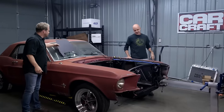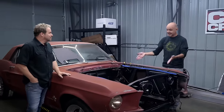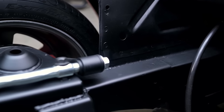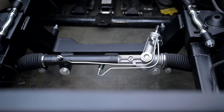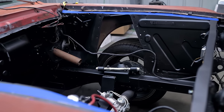We are back from the Power Tour and back here working on the 67 Mustang Coupe. This thing looks great under the hood. We spent a little time doing a super clean on all of the metal, replaced some of the seam sealers that were all crusty from the factory, blew apart the suspension and finished up any welds we may have missed during mock-up, got a good epoxy primer on it, and a good single-stage flat black paint that looks exactly like what Ford used in the 60s.